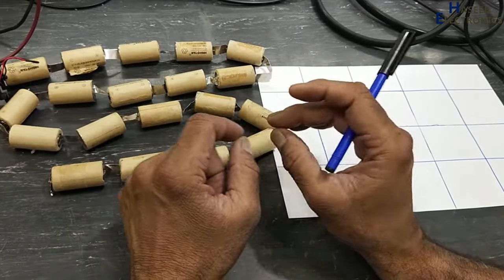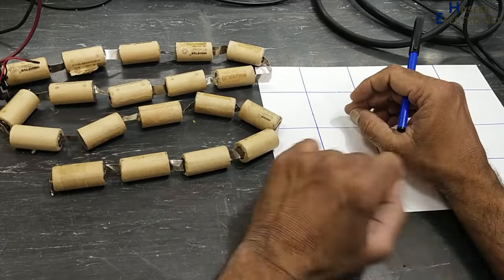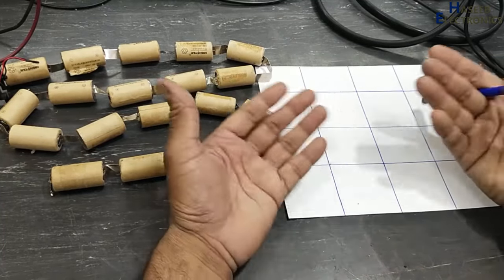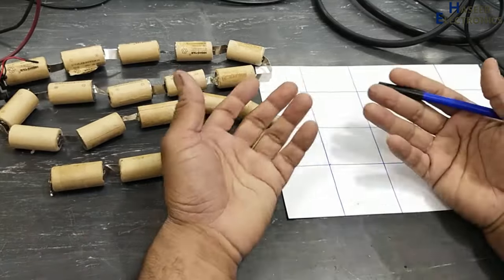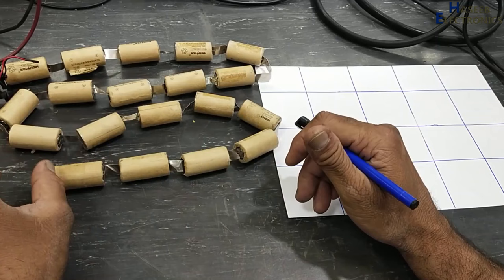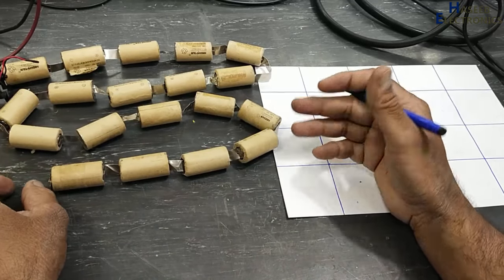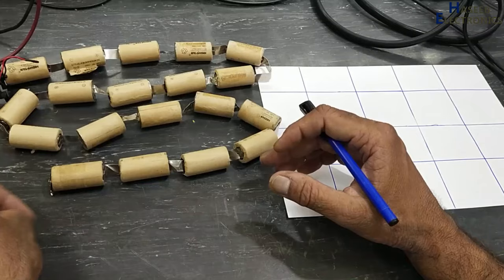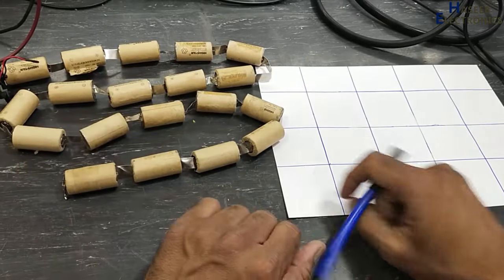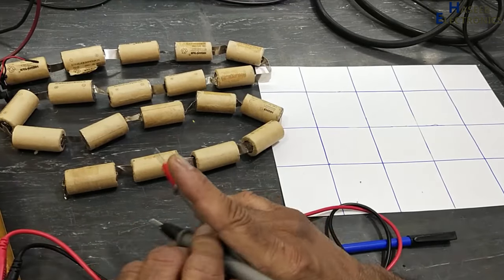Let's study why it is not charging. We will enter data and then summarize it — why it was not charging, and what the recovery options are. The 20th cell was infected with corrosion and sulfates, so I removed it. Now we have 19 cells. In the first step, we will note the battery voltage.